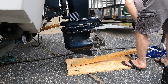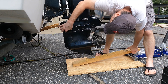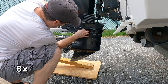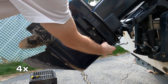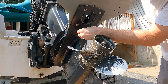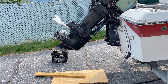I used the jack and a 2x4 to make a lever that puts a little bit of pressure up on the motor, then I go to the throttle and put it in gear and out of gear, and that allows the lower unit to slip up into place. Don't forget the fifth bolt down underneath. That's the reassembly — it was definitely tough to get it back together, probably partly because the motor is so old, but eventually it got there.